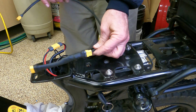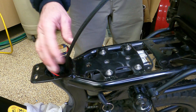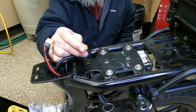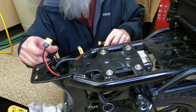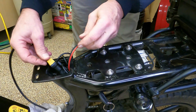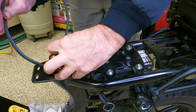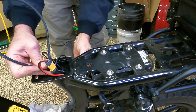I'll leave links to the XT connectors, cord protector, and heat shrink — I just bought it at Home Depot. Here is my wiring harness with the built-in splitter. The design is: this end shoves down in there, this comes through underneath here, and this comes up over here and into the box — so it'll all be modular and removable. The female connector comes off the battery, the male connector end plugs in. I'll fold that wire, plug this to my controller, and this right here will find a way inside with all these other wires.